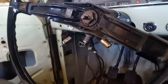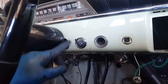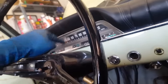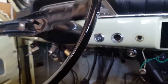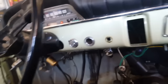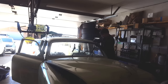The steering wheel puller will be here later today. Once the steering wheel is out, everything on the dash can come out. Shelby 1 and 2 are automatic cars and have that extra cutout for the gear shift selector, a different collar on the steering wheel, and the little PRNDL switch. Removing an old windshield without breaking it is a really big task, but the easiest thing to do is take your time, be diligent, and have a lot of sharp blades available.